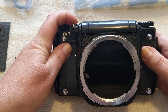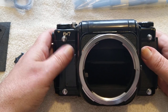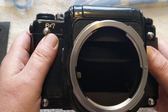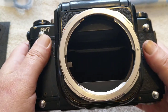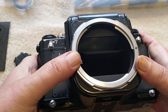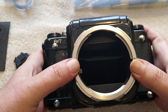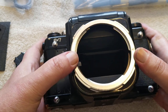What happens is this — it stops. And it's really annoying if you've got film in it. That was the issue with this camera; it would do this repeatedly. You can probably see the mirror has not completed its travel, but worse than that, the second shutter curtain hasn't moved. So at the moment, if there was film in there, it will be exposed. You end up with a blank frame that's totally overexposed — all you get is the backing plastic basically. But the price of film and getting 10 shots per roll, particularly for shooting color, that is really, really irritating.